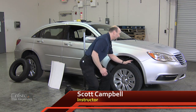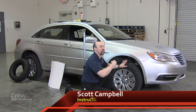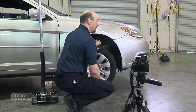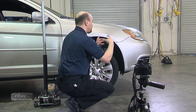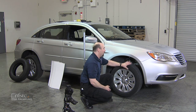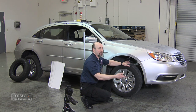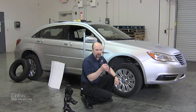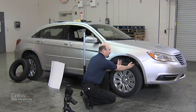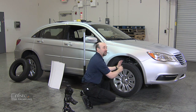I'm going to have to photograph each section of this tread. Before I do the exemplar, I want to photograph it. I'm going to have to break this into sections rather than just randomly taking photos. If we do find something in our exemplar, we need to be able to relate it back to where it was on the tire, and I need to know if I'm looking for a particular wear spot that it was in a particular area as opposed to looking at the whole tire.